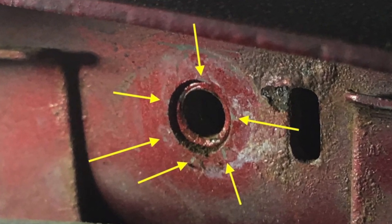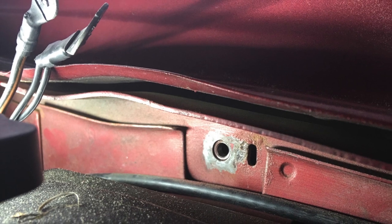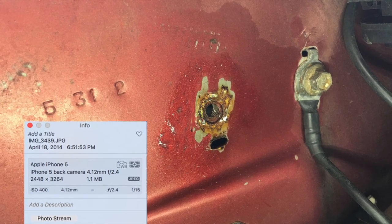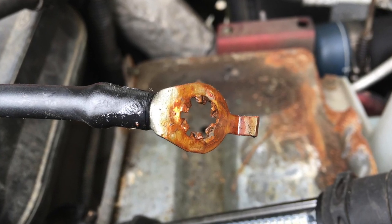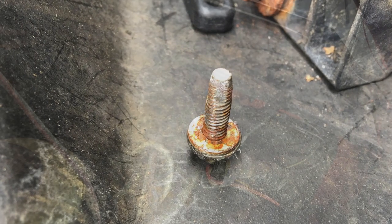The only thing in the way of better electron flow is paint. With a tool like a Dremel and a wire brush tip, it's easy to get that paint out of the way — maybe a good thing, and maybe not. Back around 2010, I removed the paint under the 8-gauge negative battery terminal at the fender, as well as the ground next to it for the vacuum pump. It was a common practice at that time to clean the surfaces, bolt everything back up, and then cover it in grease. After a few years, that didn't work out too well in New Jersey. Along with the rust on the panel was iron oxide transfer to the terminal, and the only points of contact were the tips. The bolt rusted too. This needs to be protected better than what I did back then.